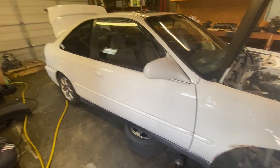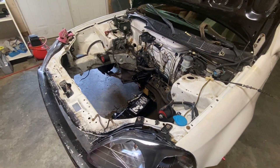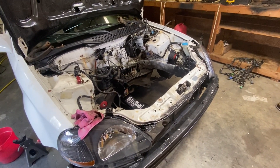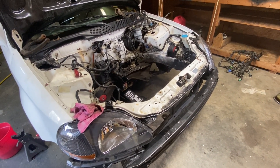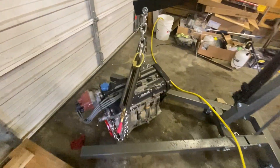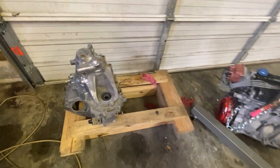Alright boys and girls, in wide view here we have no engine. I'm going to encourage you to follow me on Instagram and Facebook — some of the stories and posts are a little easier to keep up with than trying to put it all into a video. Yesterday, a lot transpired. The transmission I actually got out before I decided to pull the motor. The engine had a leak on the back on the water tube, but once I got it out I was able to see it clearly — in the car everything was just nasty. I got the transmission out, got it all cleaned up with the infamous oven cleaner and a little bit of wire wheel, and it's A-OK.